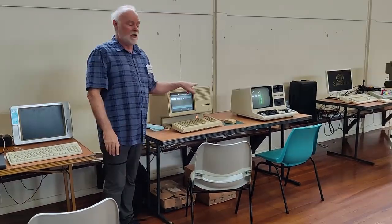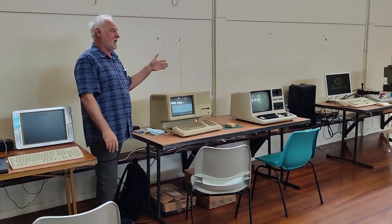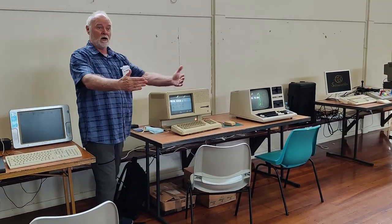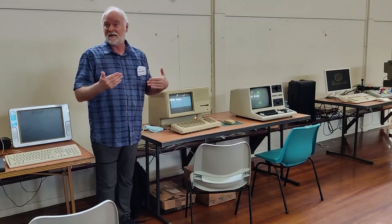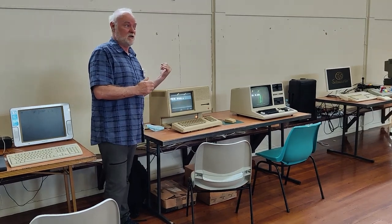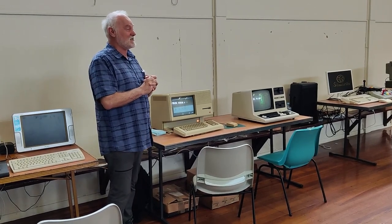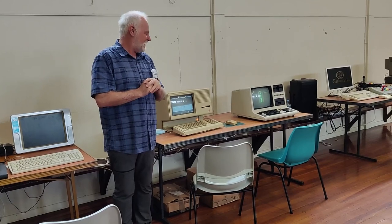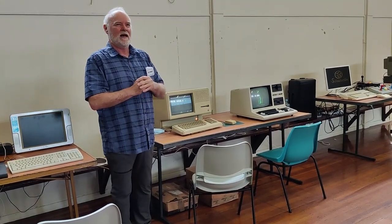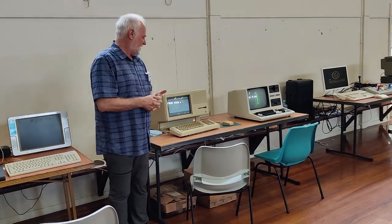Same with Profile. I can also show you just how easy it is to service these things. It's really easy. You just undo the back there and the whole thing slides out in a cage. So you might like to see that. I can sort of take it out. It's very easy to do. And you can see what the internal arrangement is. That's been the last user serviceable Apple, pretty much. And it is quite serviceable. As I said, I had these three and I did manage to cobble together two working units. They all needed a bit of work. All the drives were seized up, but certainly they could be done, even by someone like me. So you're quite right, they are serviceable machines.